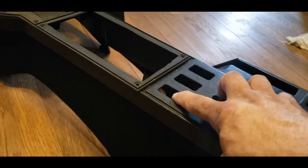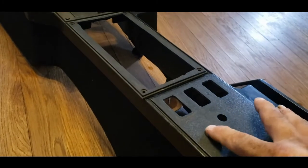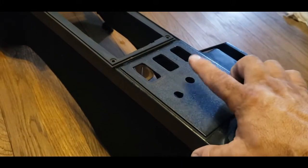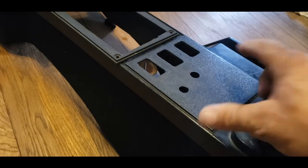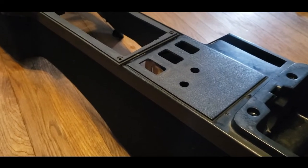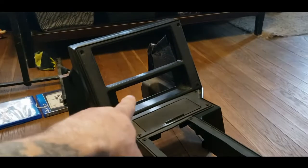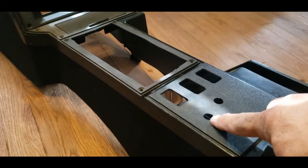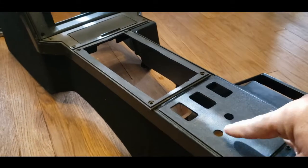And we've got your left window roll down, right window roll down, and your trunk pop. I was thinking if we drill a third hole here to kind of match what's already going on. Somebody might have had a nitrous and a purge button or something here. I'm thinking if we do a third button here, I might be able to do something for turning the amps on for the car stereo. Since I'm putting a double din in, the heater control may not be working, and since we're only going with heat only, I may be able to change it from circle to square holes and do a third one here, which could end up being a dummy.